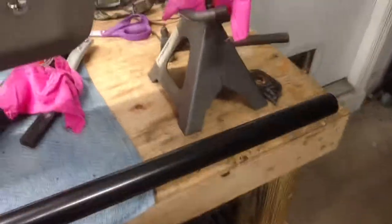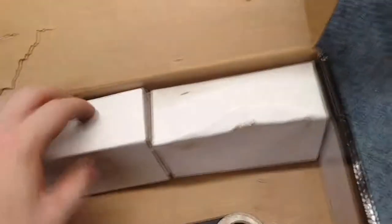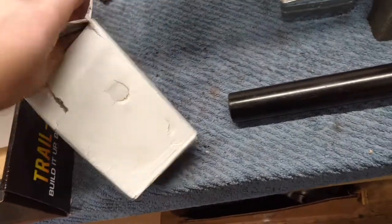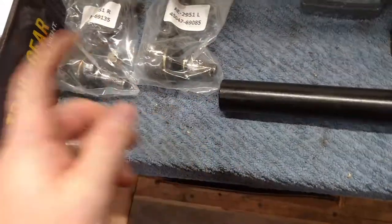I've dug out the tie rod crossover bar that goes in between the two ends. I took two squares — got some help from my wife — butted them up flush to the spindle face, measured between them, got them close enough to equal. Just kind of getting them straight-ish. These are going to be FJ80 tie rods — a pretty common upgrade, especially when you're doing high-steer stuff. Guys looking for beefier parts use the FJ80 Land Cruiser tie rods. It's got a left and a right — this thing is tapped left and right.